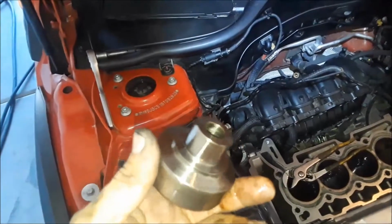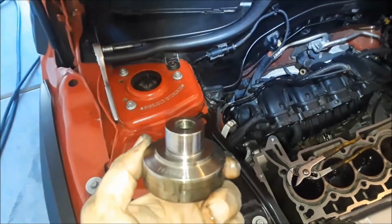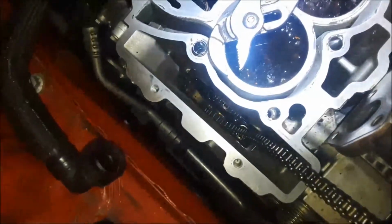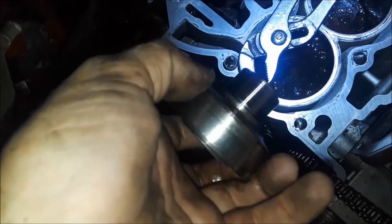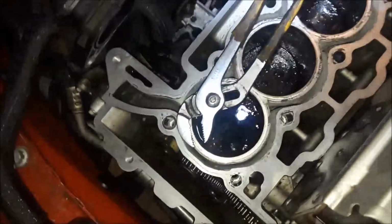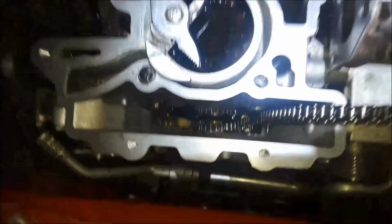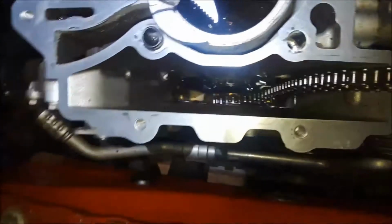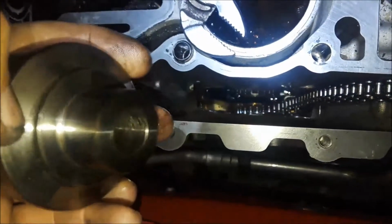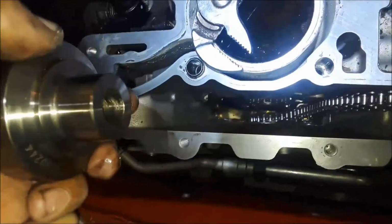And the thing is, when these things get put on, they have to be torqued to the exact specification, because these things have no locking key, and so when you tighten this up, it pinches that gear right there. It pinches it with torque and holds it in place. So you can imagine, if you did not torque that enough, that gear would slip, and your crank would turn without the cams turning, and that could cause bent valves and whatever else happens when you lose that gear. So make sure that when you reinstall this piece, it is installed to exact specs. If I remember, I will post the exact torque sequence for this piece in the description.